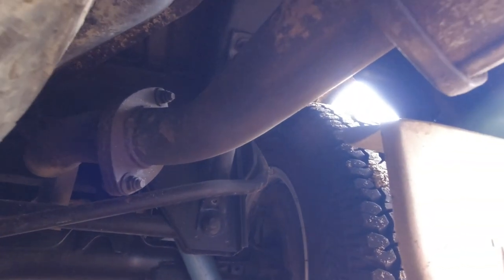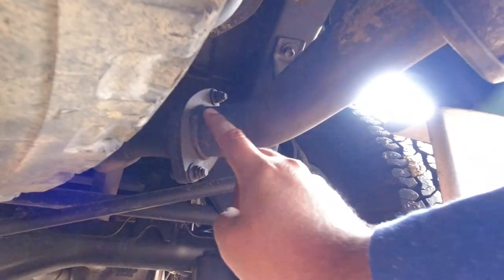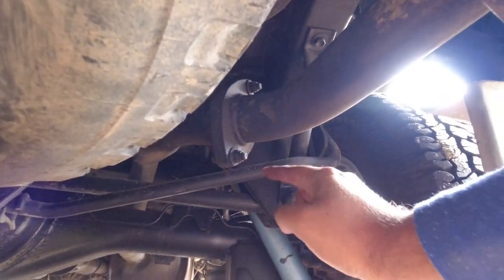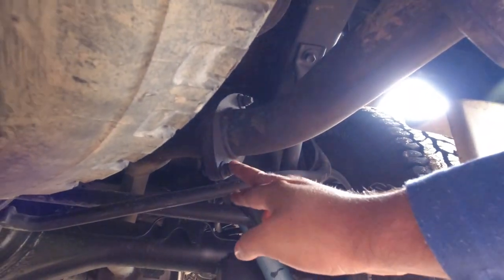It is a complete bolt-on exhaust, so if it's been changed, it won't have the bolt-on flanges for different parts of the exhaust. Say this is the back box and the muffler itself. Most custom exhausts, they'll just weld everything together, and it'll just be maybe two pieces, but the original exhaust will have complete sections that are bolt-on. Again, making sure that the bolts aren't rusted through, which will indicate the vehicle's been used near the seaside, near the docks, near the ocean, or driven on the beach. And so when time comes to replace certain components, bolts will be rusted through.